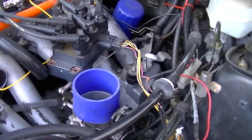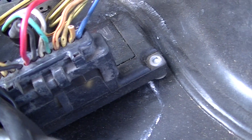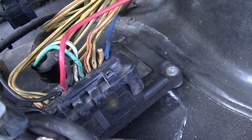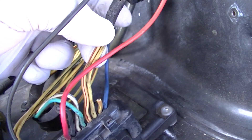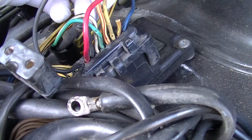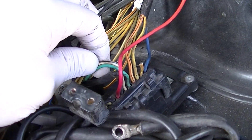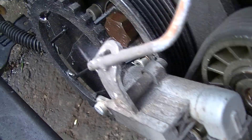As well as this coil pack. I have my module here, and I just have my power and my ground — these two and then these two right here. This blue one and then this yellow one, one and three, because this one is just a ground that goes around it. And these two wires go to your sensor and it just reads those teeth.